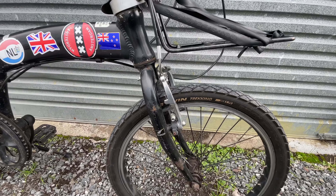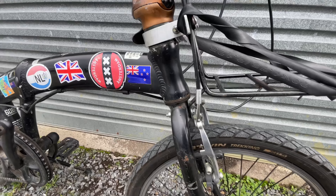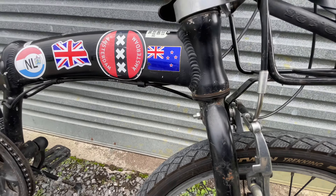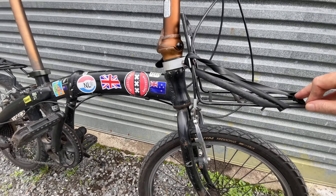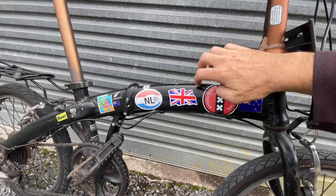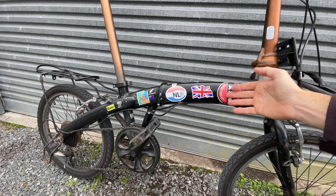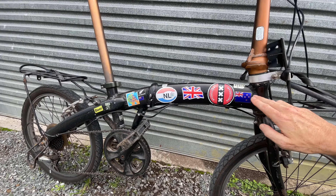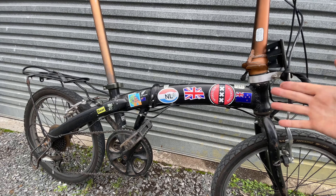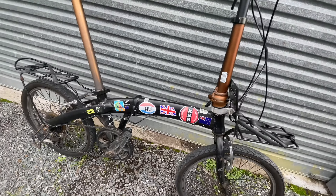So replacing the brakes and removing the mudguards was the first upgrade I did on this bike. You can see if you look closely there are still signs of rust — they were on a sailboat for about three or four years out on the ocean. But because the frame is made of aluminium it's a pretty good sort of bike to get for a project. You're not going to get rust in that frame, and although it's not easy to fix if you do get any cracks, an aluminium frame is nice and light and it's a good place to start if you're building or modifying a bike to take on tour.